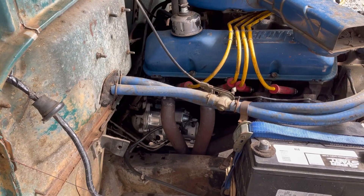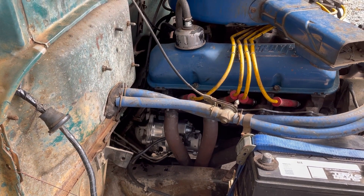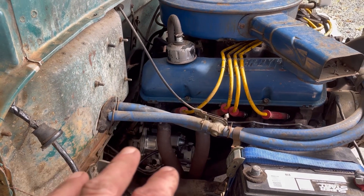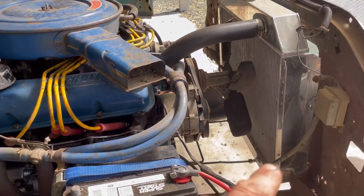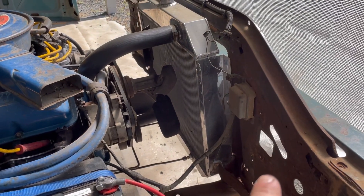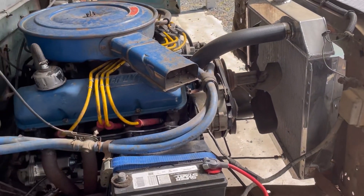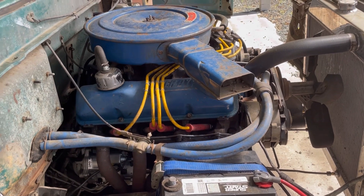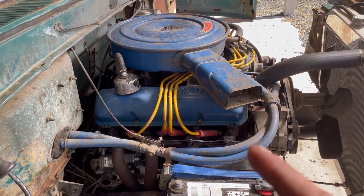That failure to fire was definitely the connection at the solenoid, so we'll just have to keep an eye on that. Pretty happy with it — it certainly frees up quite a bit of space in there and should eliminate any possible issues with heat soak on the starter. I think that's the last project I really needed to get done before we put the front clip back on. The core support and bolts are on their way, should be here early next week, so next weekend we'll pull this rotten old core, pour it out, get the new one in, and start piecing things back together with the new inner fenders. That's all for today — thanks for watching, we'll see you next time.